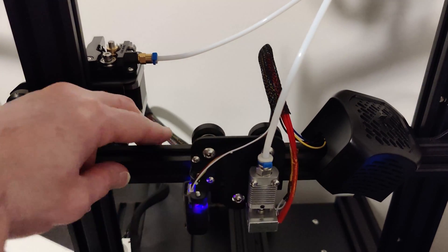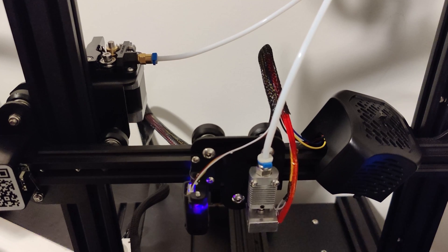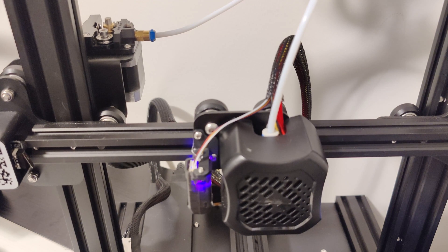Once you know it's bottomed out as far as it'll go, put your pressure fitting back in, put your cover back on, screw it down and you're good to go. You've now rebuilt some of the main hot end components and hopefully cleared a clog. Go ahead and try a print. If you still have issues, it's likely not a hardware problem — it could be nozzle-to-bed distance, printing temperature, or something else. Hopefully this fixed your issue and you were able to rebuild the hot end easily enough. See you in the next one.